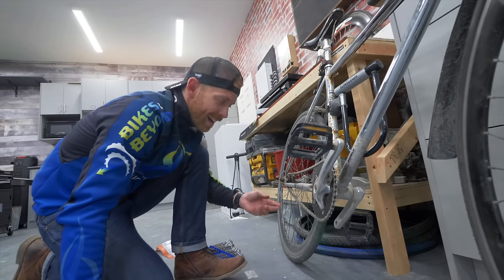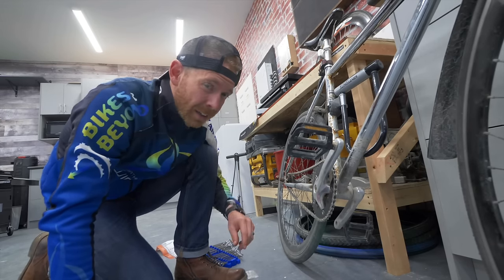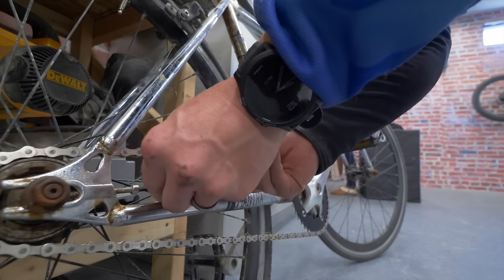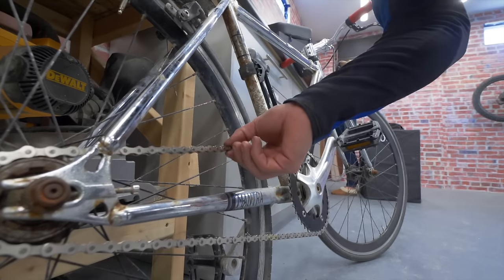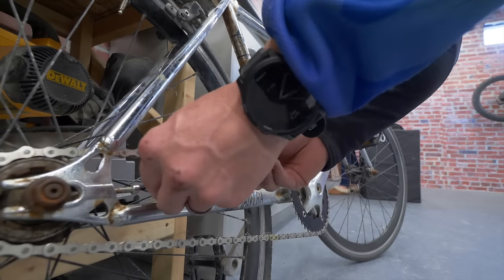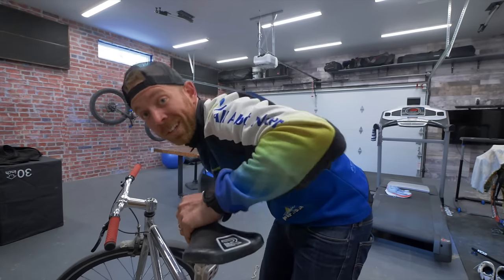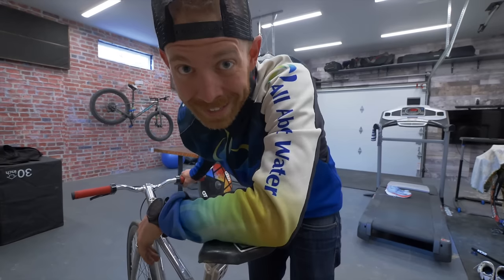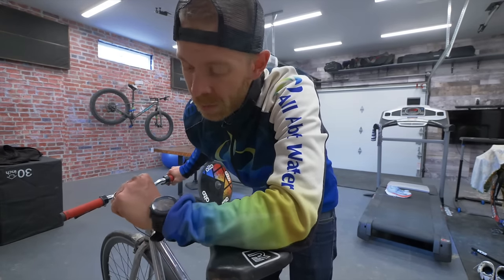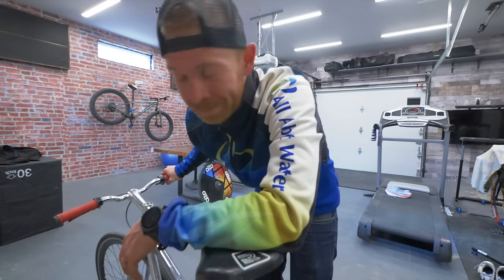And we move the wheel back so it's nice and not tight, but snug. Basically right around here where there's a little bit of give, but it's not sloppy, just kind of like this. So with your finger, you can move it. There we go, not squeaky. And that is how, in just 37 simple steps and an hour, you too can have yourself a new, fresh chain.